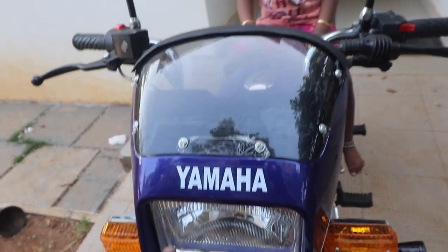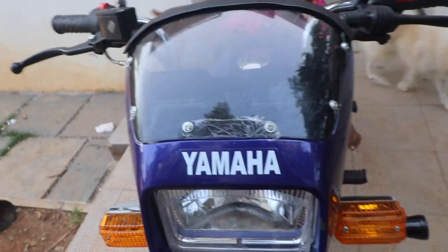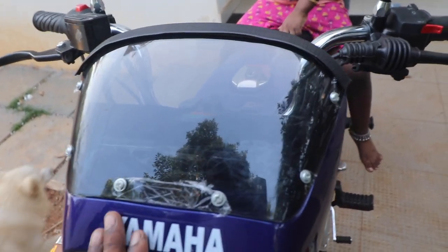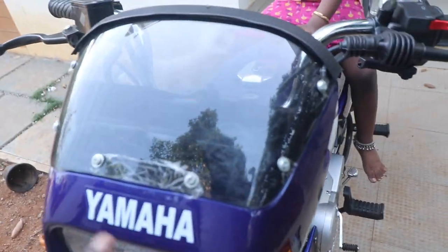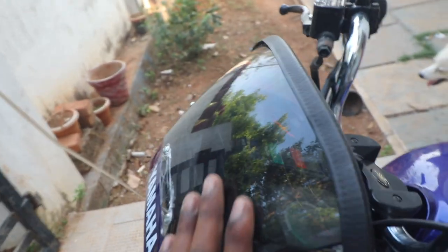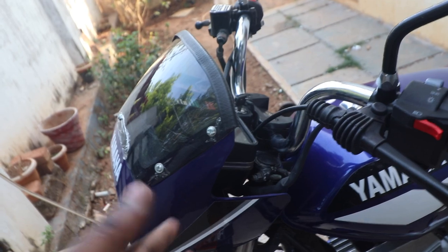The second option is the non-clear glass dome, and the third option people use is the Type 2 mini headlight — you can see it in all three configurations. Then there is the mask — you can rock the mask to check if it moves, which means there is no clamp underneath. There is a clamp that comes underneath, so check for that. Also look at the condition of the visor; if it is too damaged you may have to change it, and check the visor beading — what I have is not the original beading, so look for that if you want originality.